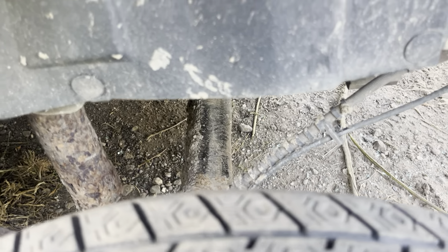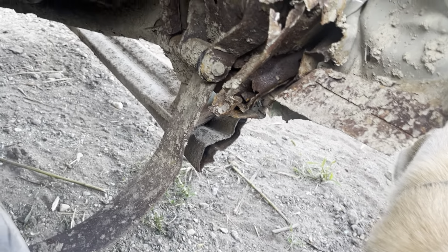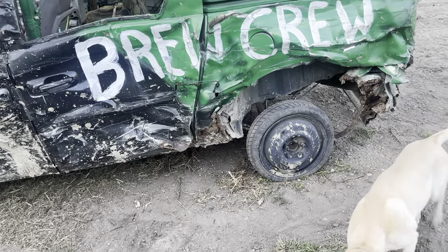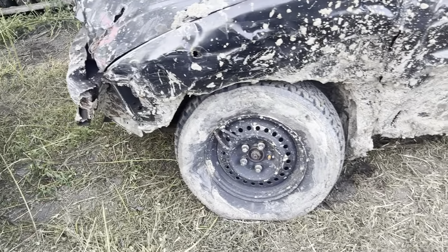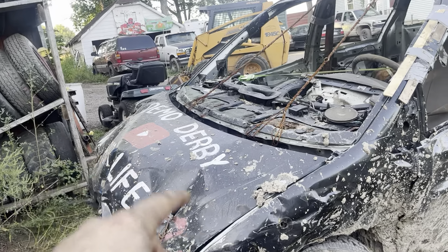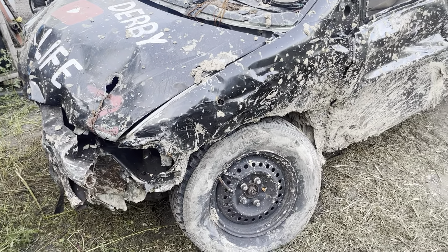Both sides did break. You can kind of faintly see back here — see how it's kind of angled, kicked downwards? It should be straight. The leaf spring is broke here — you can really see that's all kinds of screwed up. It might not be broken actually, but I think it is. A couple little door dings on this side. Both struts are slightly bent, not really worth saving. Oh, that side I'm going to try to save because it was an aftermarket strut and it's basically brand new. I'm going to see if I can get it to bend back straight and then try plating the strut.